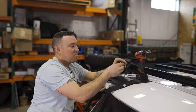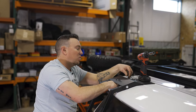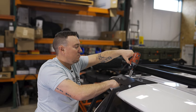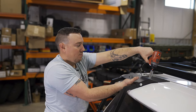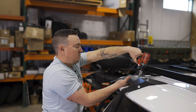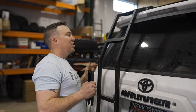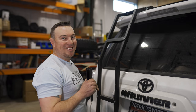So we got the bottom tightened up. Now we're going to drop a washer over each bolt, slide our hand underneath, hold the carriage bolt into its slot, and tighten these guys down. Our last step is we're going to install our final remaining two rungs. This is our co-worker's truck actually, so we were going to put them all up top so he can't even use the ladder, but you'll probably want to install yours to where it makes sense.